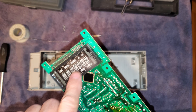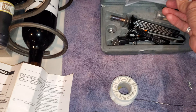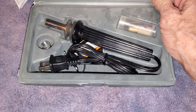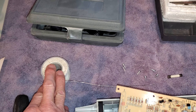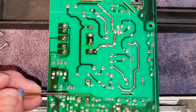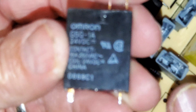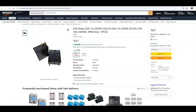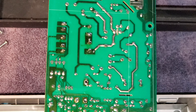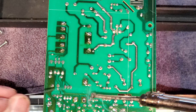We're going to go ahead and re-solder that connection. To re-solder, you can use a standard small iron — it will work fine. I have a heavier duty soldering gun that I prefer, along with rosin core solder. You can see these three tabs. I've removed all the old solder, so you can actually remove this relay and see it clearly. You can use the part numbers to order new ones if needed — I found them easily available online. I'm going to put fresh connections on here — don't overdo it.